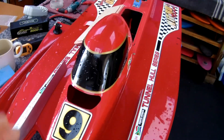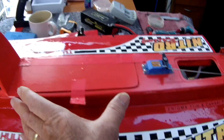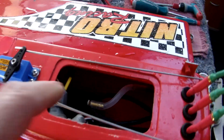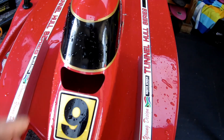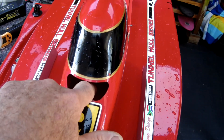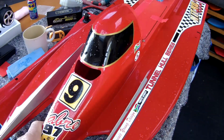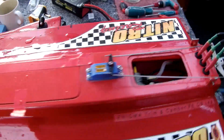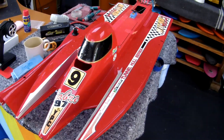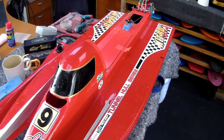Just for those wondering what I'm up to here — I put a slot in the front so we can have airflow going through the fuselage, basically cooling the battery, cooling the leads and plugs, adding extra cooling to the ESC, and exhausting also over the motor. Even if it's a few degrees, it all helps because heat build-up is exponential — the lower you can keep it, the better. You saw when I brought the boat in, the LiPo temperature was right down to 20 degrees. The LiPo batteries tend to heat up after you've unplugged them. The air comes through and exhausts out the back, and it's basically the same concept they use in electric aeroplanes — that's how they cool them. Seeing that everything in the boat is waterproof, why miss an opportunity to add extra cooling to the system?